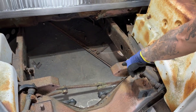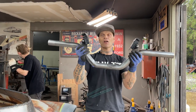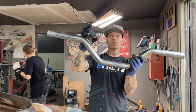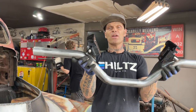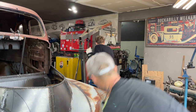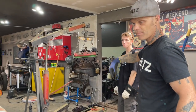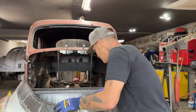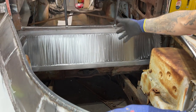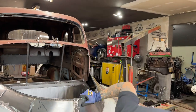The reason I'm going to put the engine in is because there's two mounts welded on the frame already. I don't know if I've ever showed them before, but there's two mounts that someone has welded on that frame and it's pretty rugged — that's not going anywhere. The two mounts I think are for the flathead off the water pumps, but that mount right there makes me awful suspicious that it's a 350 mount or small block Chevy mount, because I have one right here. We finally got our order.